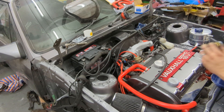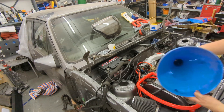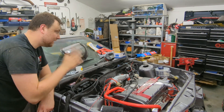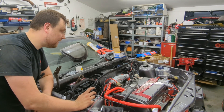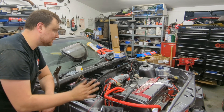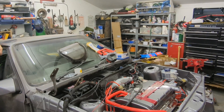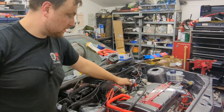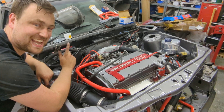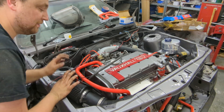It's now time to put some oil in and start connecting wires up. I've connected the ECU, connected the ignition feed to the ECU, put the battery on, and the fuel pump is wired up. Everything's plugged in and all hoses are on. I've cranked the engine to get the oil pressure up with plenty of oil in now. Whoa — that was a genuine first start! I've now connected the intake to the turbo — it hasn't got an intercooler but I've roughly put a pipe on just to give it another go, since it won't run properly without that.